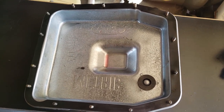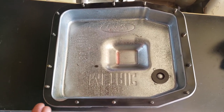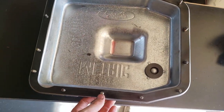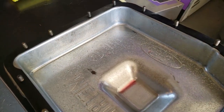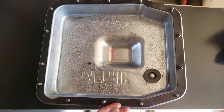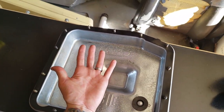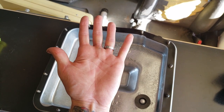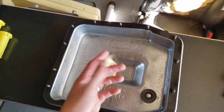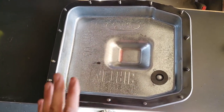The best way to do this — you have no room, you've got one shot at getting this gasket on in one piece. Put your bolts in from the underside. The new gasket holes tend to be smaller than the bolts themselves, so even though the bolts are upside down, they're still maintaining their place and keeping the gasket in perfect shape for when we put it to the car. We're going to hold it like a pizza, place it into the holes underneath the car, hold it steadily, then slowly do these diagonal tightenings just to hold it in place, then let go and bolt the rest in.